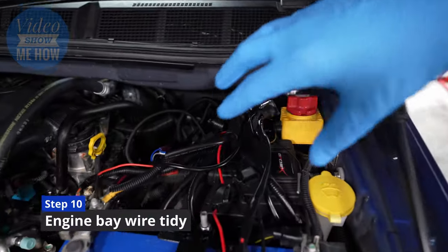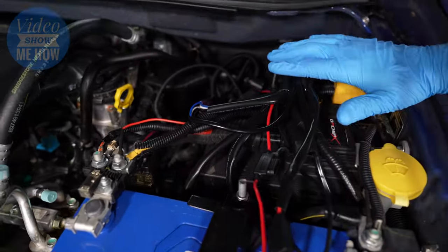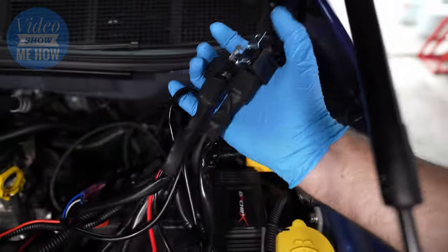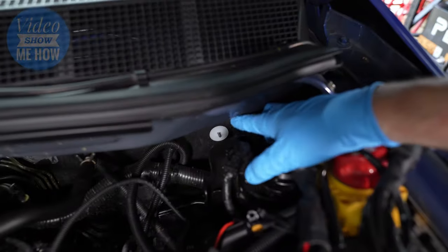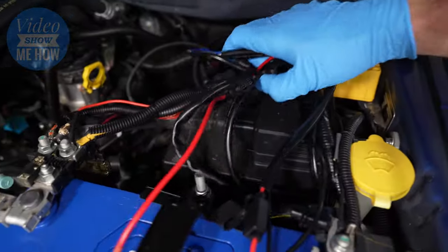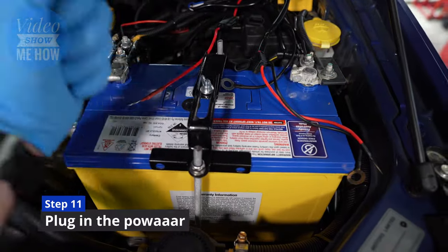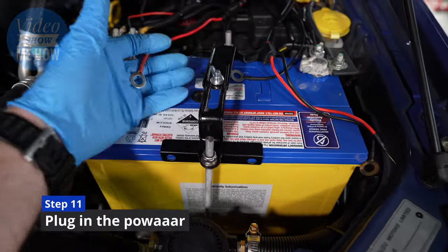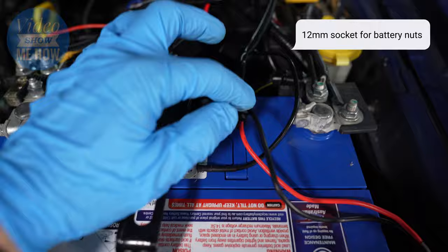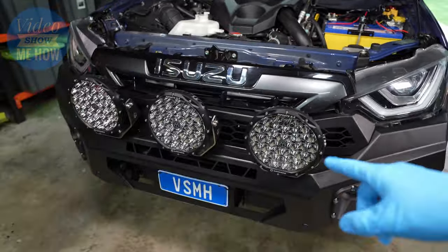On to our final step — sorting out the spiderweb we've created here. You may or may not have as much 12 volt gear as I have here; I've got a plate coming to tidy all this up, you'll see that in a future video. For now it's a matter of tidying up your relays — whether you have both or just the one. Make sure you apply double silicone on any cut you've made in the grommet, then it's zip tie central — tidying all of this up so nothing's against the engine. The final step is plugging in the battery: positive on this side and negative on this side. Get those fuses back in place — if you're using the double make sure your 15 and 30 amp fuses are in the right way.